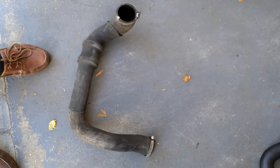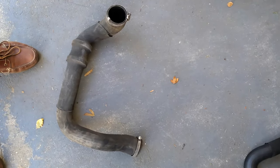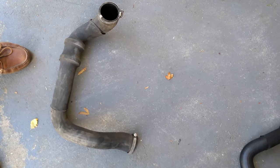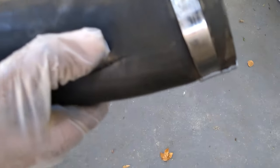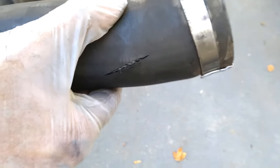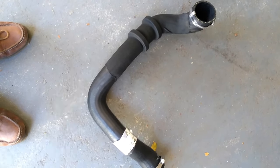The old pipe is out. One thing I did have to do was take the floor panel off because the only way to get the pipe out is to push it through the bottom of the car. Not too bad — I tried to do it without taking the floor panel off but you can't. It's only about six screws. Here's the old pipe with its two jubilee clips, and as you can see right there is the hole — that's the culprit. It's a common fault. When I went to pick up the pipe the supplier said they always keep these in stock because it's a common fault. Now we've got to get the new pipe back in through the bottom of the car first, then put the ends back in and tighten the jubilee clips.